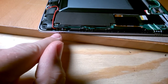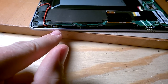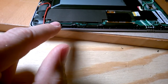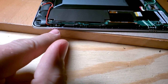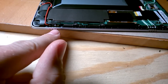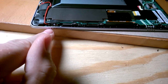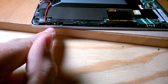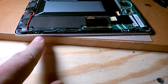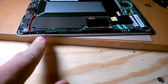Down here on the four original pins, this used to be ground, audio, audio, and dock power. What this is now: ground — I actually left that one alone because it's a chassis ground, a good ground. This pin is now linked to the ID pin, this pin is empty, and this pin is 5-volt from the USB port.